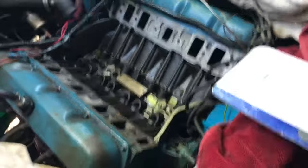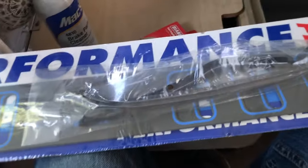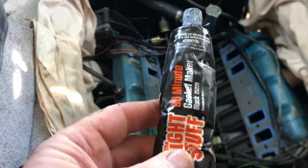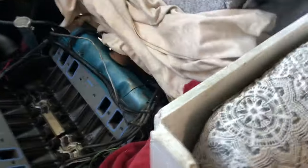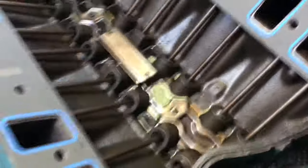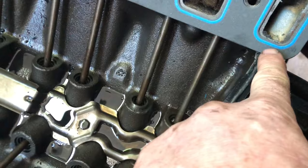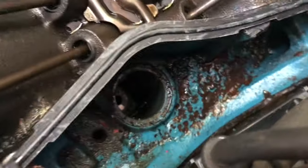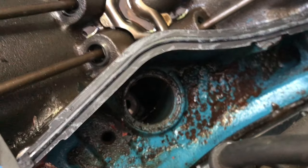Now that's all clean. I'm going to put these gaskets on — put a little bit of silicone on there and stick them on while I'm cleaning off my intake, and then they'll be set and won't move. There are my gaskets on there. I use just little dabs underneath on some flat surfaces to keep it from moving. I've got my nice rubber pieces going in between, and before I put the intake on, the last thing I'll do is put a couple little drops of RTV in those corners. Then we'll bolt it on and hopefully have a not-oil-leaky intake manifold.